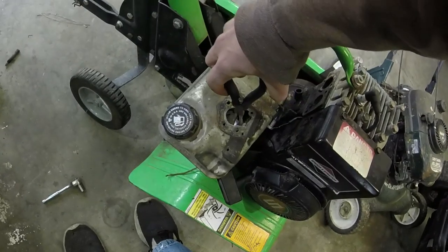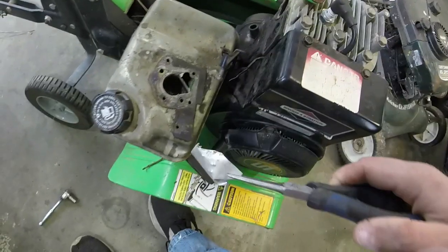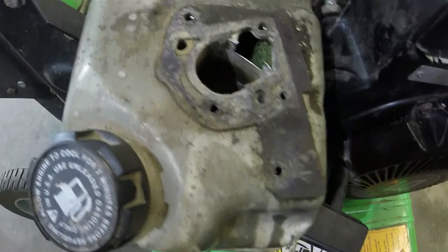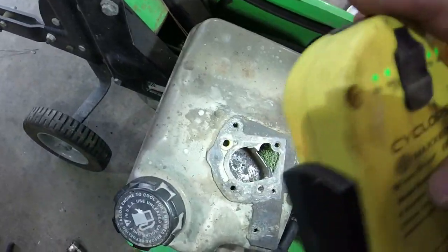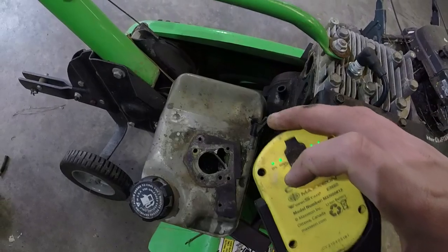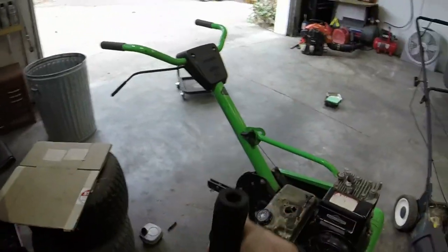I'm going to dry the tank out, wash it so I can neutralize everything, and see if I can fix the holes in it right here with some solder. Now, of course, it's got a lot of little surface rust and stuff on it. Sorry if my camera's going all over the place. I want to grab my flashlight and show you all the holes again, because it's been a while since I shot this last clip. But where are we here? That little hole right there, and there's a couple little holes up there on the near side that I want to address. But what that involves is taking off the gas tank, which we'll go ahead and do here. I feel like I'm just shaking the camera all over the place, and I apologize.